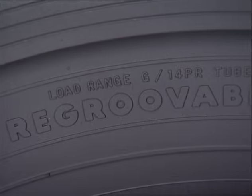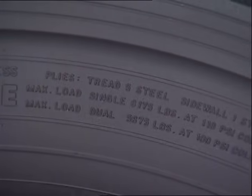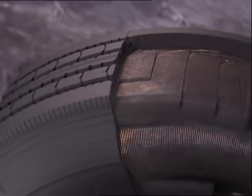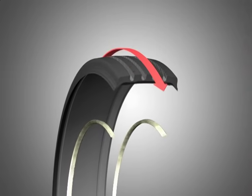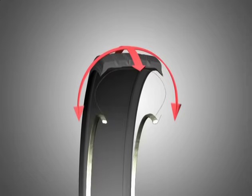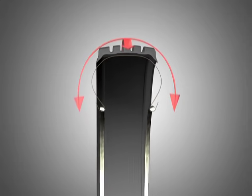Steel adds enormous strength. Long ago, a 14-ply rated tire needed 14 cotton layers. Today, just three or four steel-reinforced layers in the belt package, plus one layer of body ply cords, do the same job. Beneath the belts, we find another combination of rubber and steel. These steel cords run at right angles to the tread and run radially down the sidewalls of the tire. It is this cord direction that gives the radial tire its name.